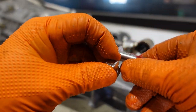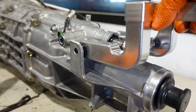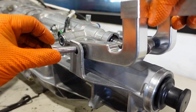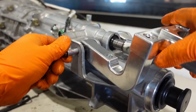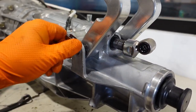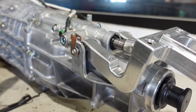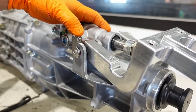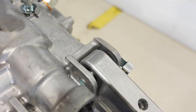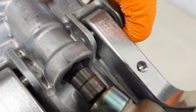Go ahead and lube your shifter base pins with grease and get one side lined up at a time. Having those large six-millimeter Allen head bolts loose will aid in this installation. If you can't get the pins all the way in, you can use a hammer to lightly tap them into their final position — but don't get carried away and break the transmission case. Light taps only; anything more than that and you're not lined up properly. Loosening those shifter bracket bolts will help you move it into place.